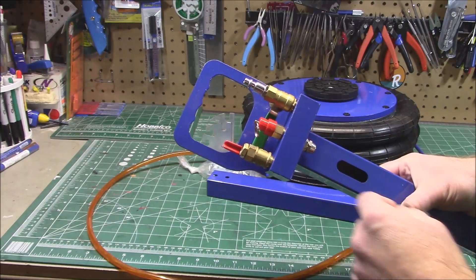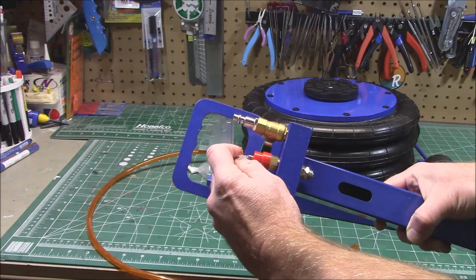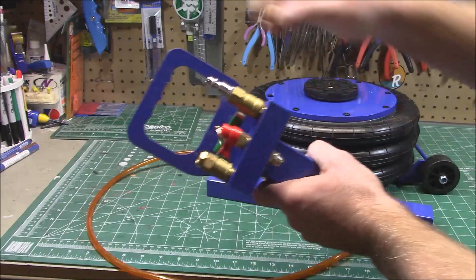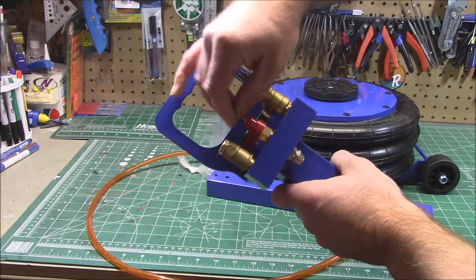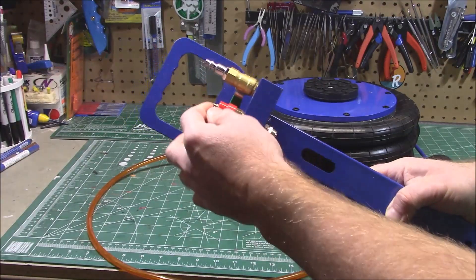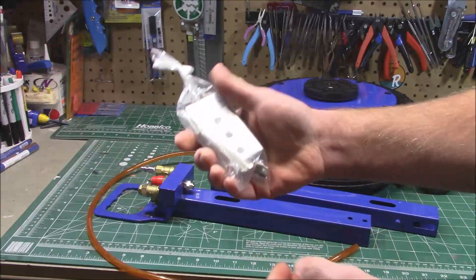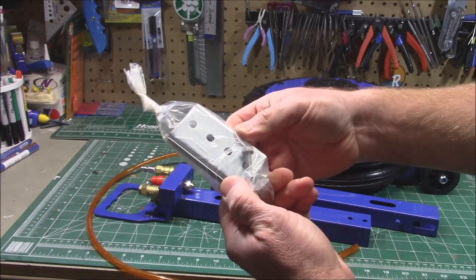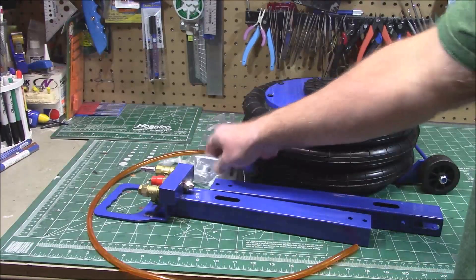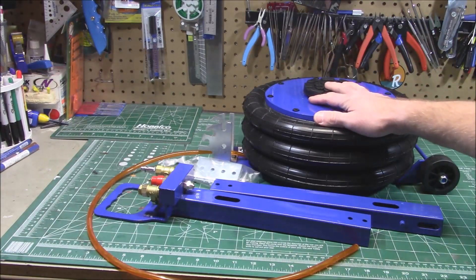If you need to instantly release air in an emergency situation, this safety release valve is here and it will also blow if you reach an overpressure stage. This little ringlet lets you pull it, so if you reach overpressure through the line, this will pop and blow before you blow the bladder. It includes all the hardware needed to assemble the handle — just some galvanized steel to bolt the handles together once you get your airline run and attached to the base.